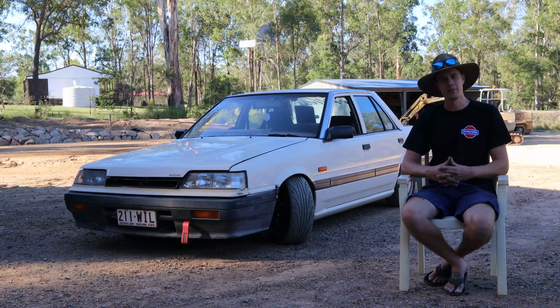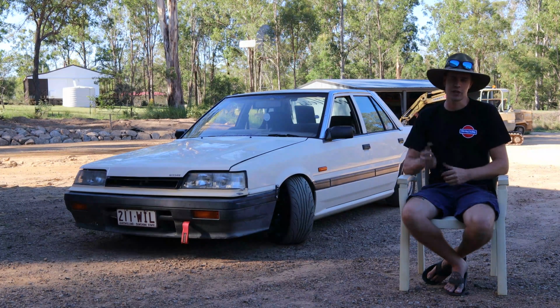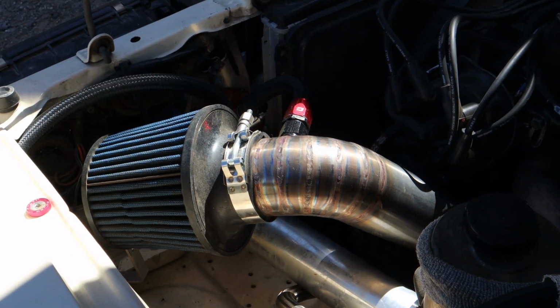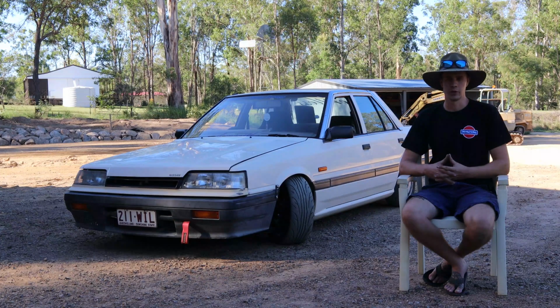So the 25% underdriven harmonic balancer just relieves that issue a bit. We've got a full custom catch can setup on the car, which was sort of built by me around the generous ring gap. So we've got vents from the sump and the cover, which help alleviate crankcase pressure due to blow-by, which helps ring seal twofold.